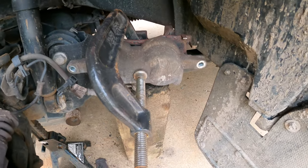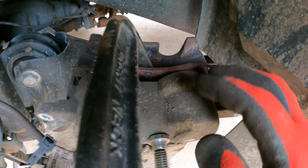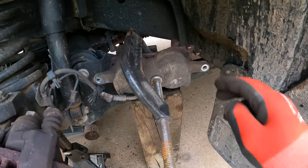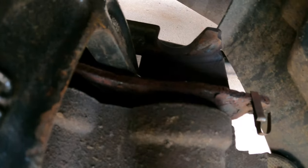To get the caliper fully compressed, I put the pad in and use the C-clamp more in the middle so I don't have to worry about the pistons compressing cockeyed. Tighten it up until they're almost flat — you don't want to go completely flat, just pretty far in.